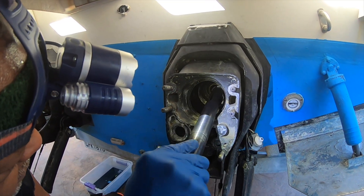And then the way to get this out — I'll show you a trick of how to get this thing out too. Because right now you got to squeeze these to get it off the bearing. Let me go to my toolbox and show you this. Put a clamp on here like this — what this clamp does is it'll squeeze these in so the bearing will come off a lot easier. You're going to see it's going to start squeezing these. Oh yeah, I can see it. That's it — that's the trick.